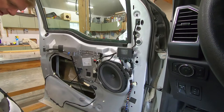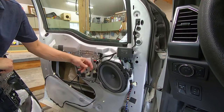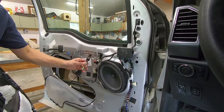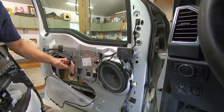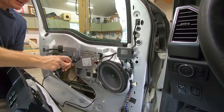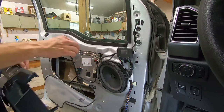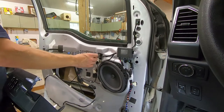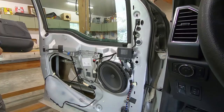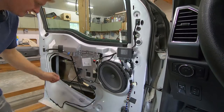Apologies — I didn't get that on camera. I was fighting to figure out how to get the door latch off, and one of the cables was really difficult to get to. Basically, you push down on the top plastic part and that frees it so it pops out. There are three different connections back here, and the one that goes to the door locks has a pretty short cable, making it a little difficult to press the release. Take your time — you can figure out how to get those plugs off, but it's a challenge.